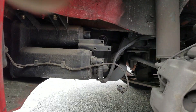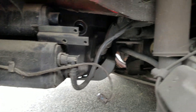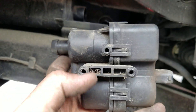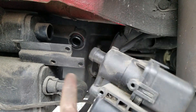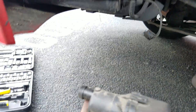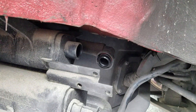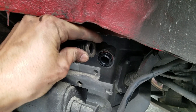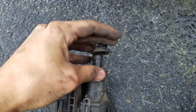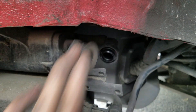To get to the part it's pretty simple. There are three screws — one, two, three — that mount the component, and it sits just like this with the front nozzle going into this canister here. If your car is like mine it's not lubricated very well. This piece normally sits inside this tube here; it came out with my part — no big deal, just slide it back in.